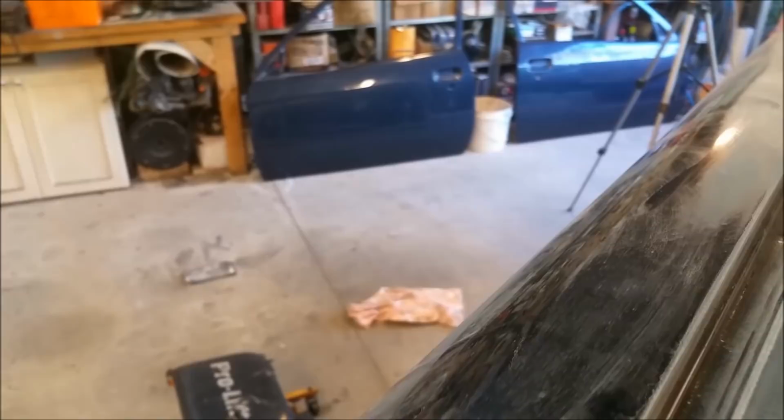So when you're sanding clear, it's white. Whether you're doing it wet or dry, the clear always comes off white. And when you start getting to the blue stuff, you know you're in the colour then. But we're through it all there. The blue's only very, very thin. The clear is actually quite thick. And you can see all that's white. That's because we haven't even got through it yet.